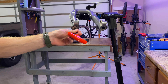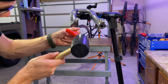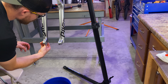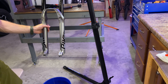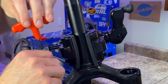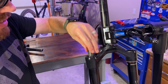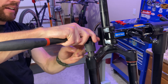First step: remove the air. You want to take a Shimano-style cassette lock ring tool, or most other forks will use a 24mm socket wrench, to remove the air spring top cap — just take that counterclockwise. At the bottom of the fork, remove the rebound adjust knob; don't take it all the way out, just loosen the set screw and it should slide out. Then take a 5mm Allen and remove the nut at the bottom of the damper and the air spring side — just back these off about 3 or 4 turns. Get your bucket for oil ready, as this is where we're going to drain the oil out of the lowers. Once you've got that backed out 3 or 4 turns, leave your Allen key in there and take a rubber mallet to give it a few firm taps to try to release the damper shaft.